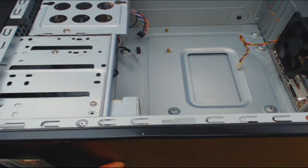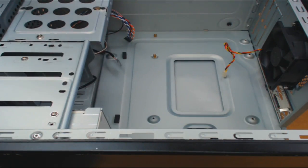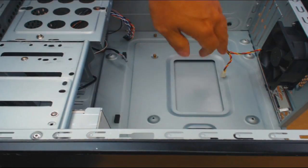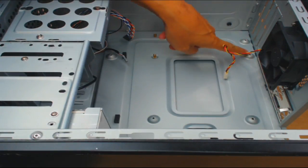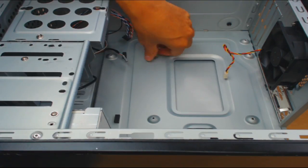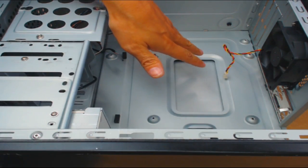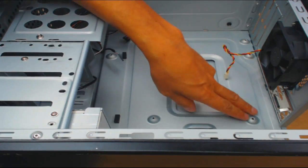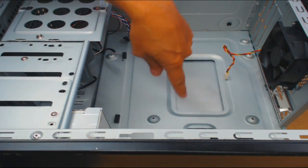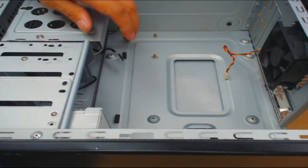So that's it — you have an empty case now. In my next video I'm going to show you how to install a motherboard — it's just the reverse. I just wanted to show you quickly how to get the motherboard out: unplug everything, keep cables out of the way, then remove the six screws. Make sure you get the correct replacement motherboard — count the standoff posts, there are six connectors in this case. You want to make sure the replacement motherboard lines up with all six. Adios.